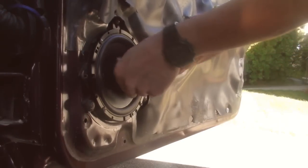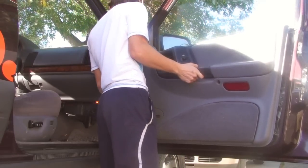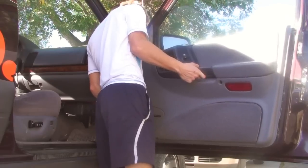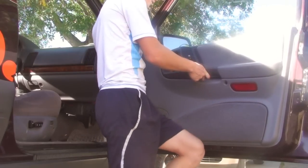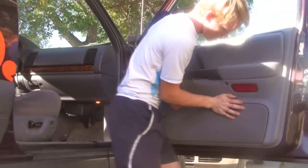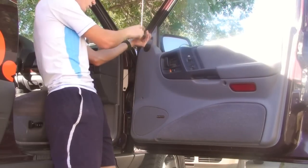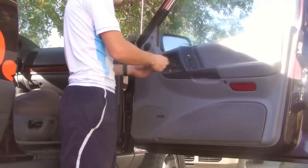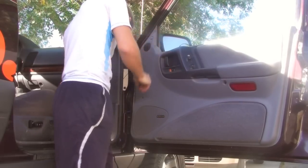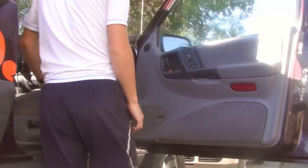Move your tweeter around if you'd like. If this is your first time putting door panels back on and you're having trouble, make sure the door handle is sticking through the little hole — that'll prevent you from getting it on otherwise. Slam it all into place, do all your screws, followed by the covers which just snap back into place.